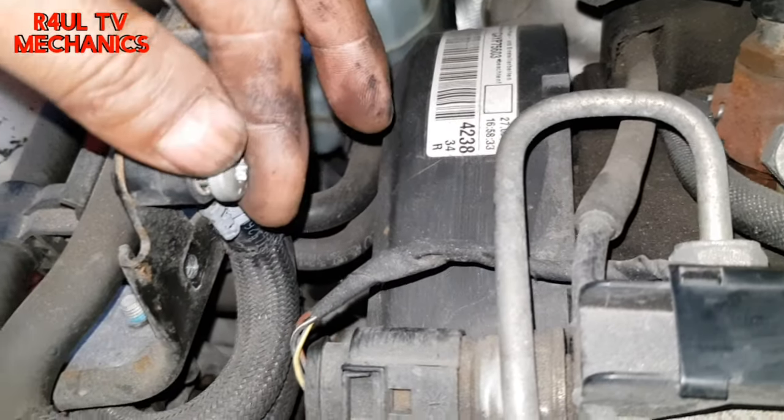O2 sensor is back on — basically clockwise, you can't really get it wrong. Use the spanner. To take it off, obviously a mission; to put it back on, not that bad because it's loose. The pipe back on, put that clip back on, put the bracket back on, and then we'll regenerate it. Hopefully everything should be all right. Okay guys, everything is back on — the O2 sensor is back on, that little unit here is back on. What we're going to do now is go inside the car.